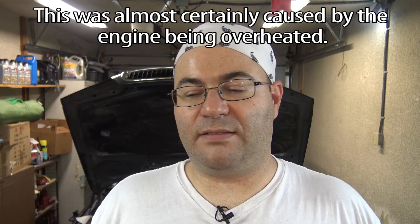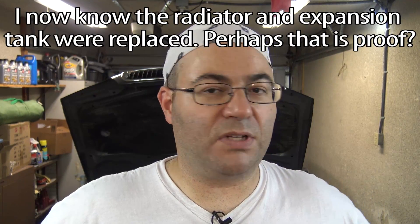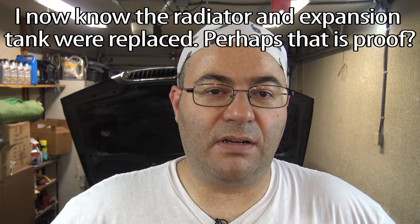It's probably been leaking like this for a while and I just haven't noticed because there is no symptom. It drives really great. You can't really notice the difference in compression between cylinder one and the rest of them — it doesn't sound or feel imbalanced at all, and it's still really fast. It doesn't sound like the engine is unhealthy at all. I could have gone on like this for who knows how long, not even knowing this problem existed until eventually that head gasket leaked in the vicinity of a cooling jacket.